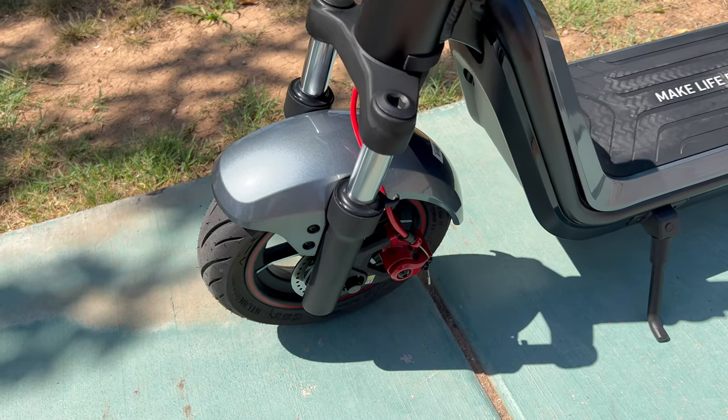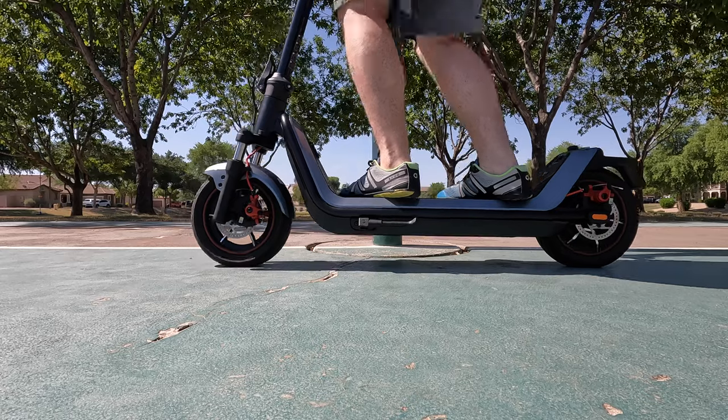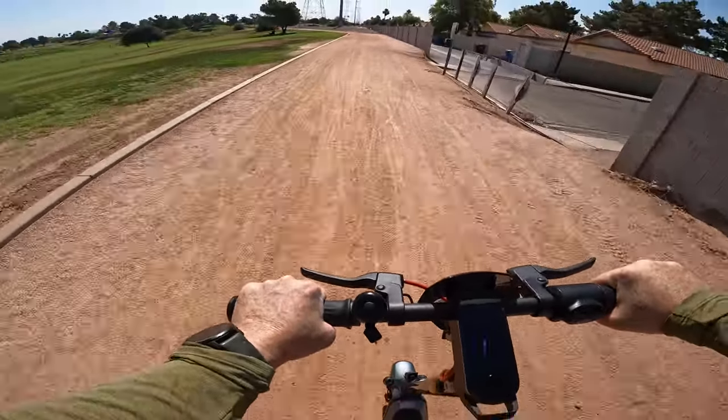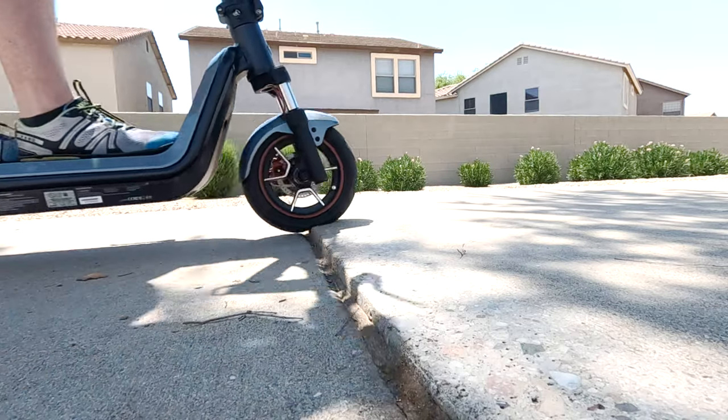The next category is suspension, and that's actually one of the defining features of the KQI 300X — it has front dual hydraulic suspension, which does a very good job of absorbing impacts. There are scooters with no suspension and scooters with full suspension; the KQI 300X is right in the middle with half a suspension, and they opted to put it up front, which I think was a fabulous idea. Having dampening in the front is important for maintaining control — scooters without suspension can get very bouncy handlebars over rough terrain. The suspension gives you 1.77 inches of travel, which is quite a bit, and as you can see from the slow motion video, that front suspension definitely puts in the work dampening impacts.